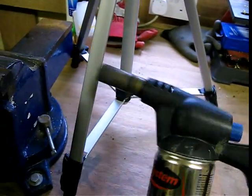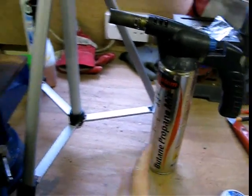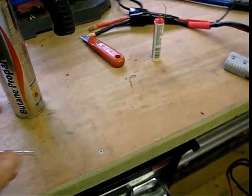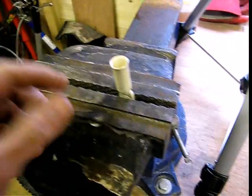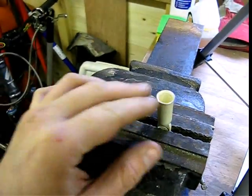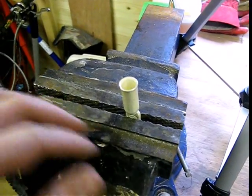Now, rather than using a normal soldering iron — that's not going to have enough heat to do this — ideally you should use a smaller torch than this but this is all I have. The idea is you heat the outside of the terminal hot enough so you can then fill it about 60% full with solder. You use a decent quality solder, get it nice and hot, then dip in the cable and slowly lower it in so the strands of copper mix with the solder. The key part is not to get any solder on the outside of the terminal, because it can affect the conductivity of the special silver outside coating. Also be careful when you clamp it in the vice — ideally you should have a soft-jawed vice, or put some bits of wood in there.